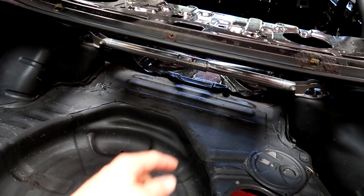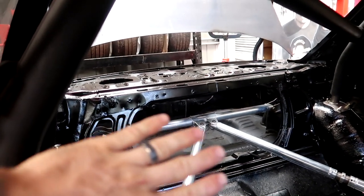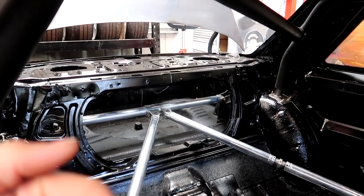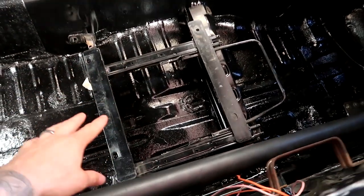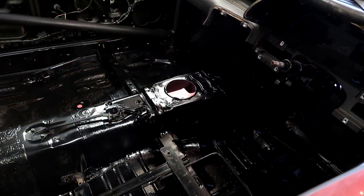There's so many things to do. I've got to make a firewall that will go in there to cover the fuel cell and separate it from the cabin, because a lot of regulations at QR for Matsuri especially require that blanked off so that if there's a fire it can't get through — even though most of the time people use stuff that would melt pretty fast anyway. The cage is looking mint. I also bought a genuine Bride rail on marketplace — sits nice and low, going to put a seat on there and suss out where the hydro's going to go.